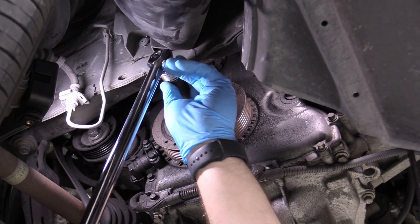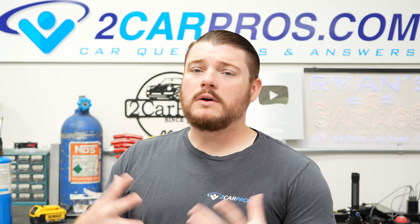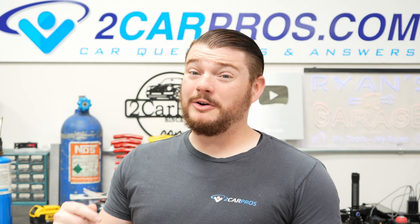This is effectively how you bar your engine over, and don't get fooled by any locked-up accessories. That is how to perform your manual rotation test, colloquially known as barring the engine over. This is absolutely essential to know, especially when you're shopping for a used engine to put in a vehicle — always a smart idea to make sure the engine at least bars over.